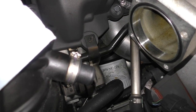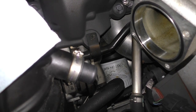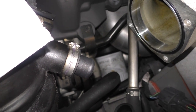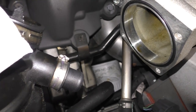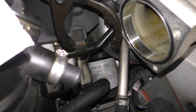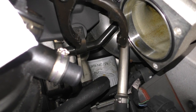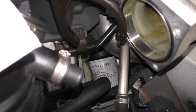Next step is to get down to that filter. The throttle body is out of the way, the O-ring is there — we're going to be replacing that. Down there we can see the oil filter. I'm going to reach down there with a set of oil filter wrenches — these make life a lot easier, especially when you're reaching down there because it is really slippery on that oil filter. Oil filter wrenches can make life a lot easier, so this is what I'll be using to release it.